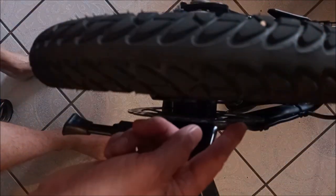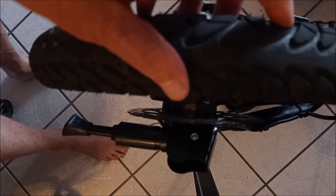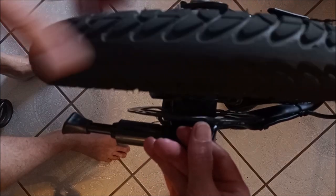It's fine now. What I did is I took a dry erase marker — you could use a chalk marker — and put a marker on both sides. Then, when I spin the tire, I could see where the brake pads were scraping off the marker, so I could tell where the high points and low points were. I also put my thumb close to it and would just spin it.